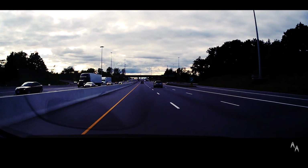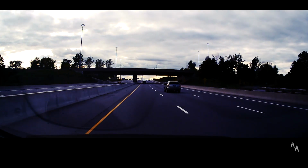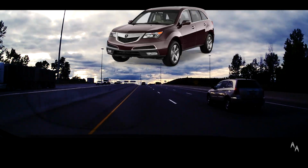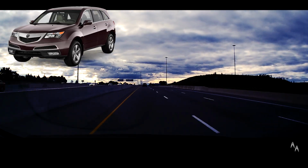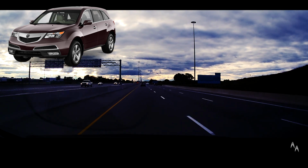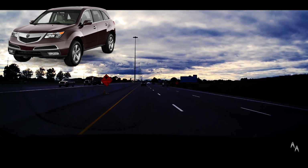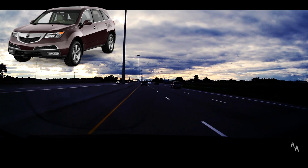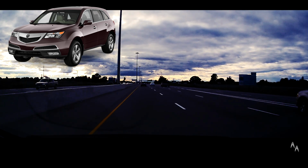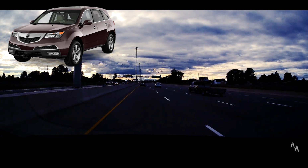The video is for a 2008 Acura MDX Tech model, which is a second generation MDX, so this will also be applicable for model years from 2007 up to 2013, with the exception of US Sport Advance and Canadian Elite models, which are equipped with ADS, active damper system, allowing to electronically adjust stiffness characteristics by changing the density of the magnetorheological fluid inside the dampers with magnetic field introduced by electric current.